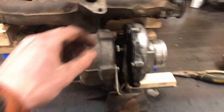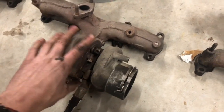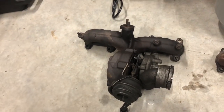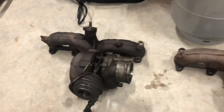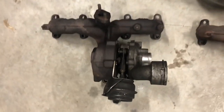Here is a BRM — the BRMs are oriented a little bit differently. The ALHs and BEWs hang down like this, whereas the BRM faces up and you can see your actuator up in your engine bay. And then here is a VNT 17, which has a pretty similar layout to the stock BEW. The difference is these are found on PD 130s and it's a little bit bigger.